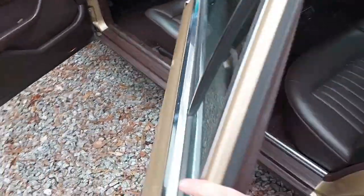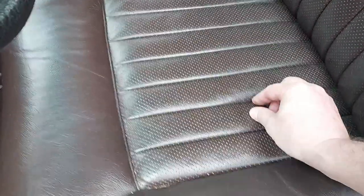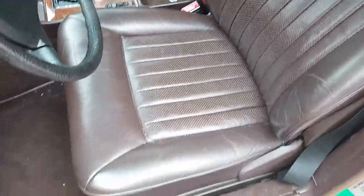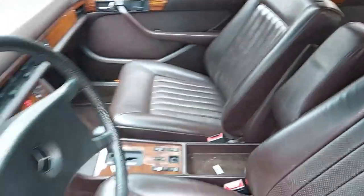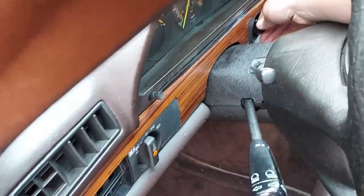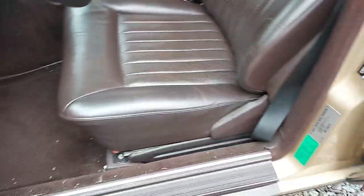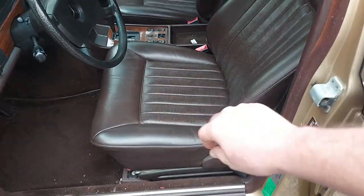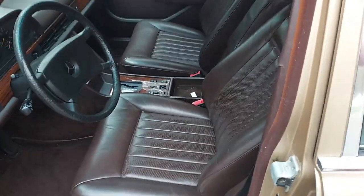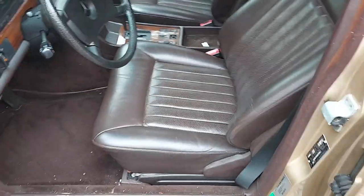Here's the back — I took the carpet protector out and that's the original carpet, it's in perfect condition. I also took the lambskin covers off the original leather seats. They're a little dusty but absolutely fantastic. I need to do a repair on the seat: it goes forward and backward no problem, but raising the back of the seat the motor spins and the seat doesn't move. I know exactly what it is — the cable that goes into the motor has popped loose.